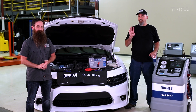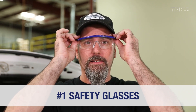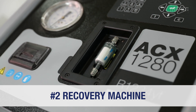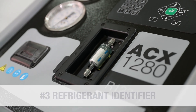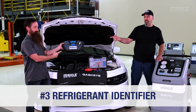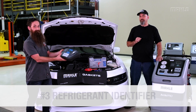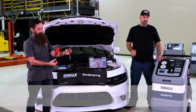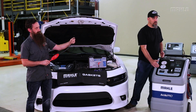In order to service these systems you're going to need four things: starting with safety glasses, you will also need a dedicated AC recharge and recovery machine with a refrigerant identifier — which can be separate as a standalone unit. You're also going to need a leak detection device, which as it happens comes with the purchase of this unit.